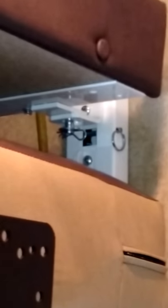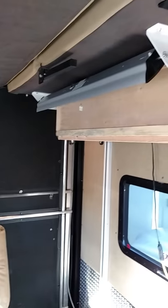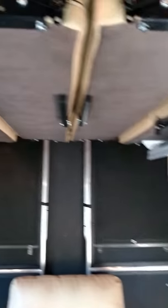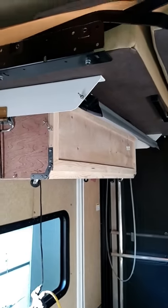I did improve where that mechanism goes. This is the one I fixed — if I go down, watch the bottom bracket come up and raise the upper one; it runs into it and lifts it. There's your little bit of play — that's one tooth. Without that space I couldn't get that pin in. The other side is extremely close — the top bracket barely moves, maybe a half a hole, but just enough to get the pin through. My adjustments were a complete success. I can now put those pins in without any trouble, and my center post does in fact come down and hit the floor like it's supposed to.